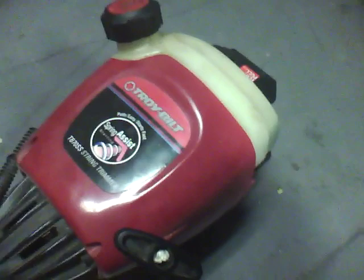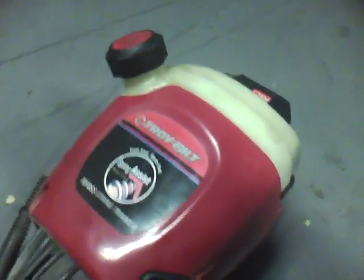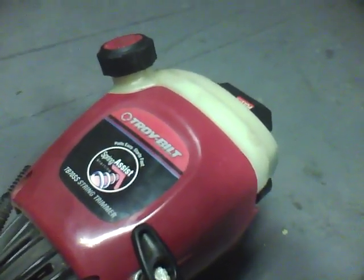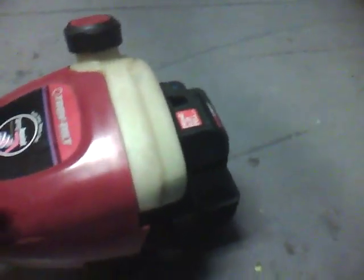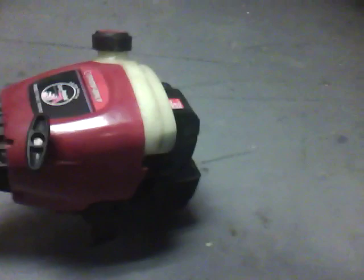The reason why it's smoking so much is I put a little extra oil in the gas. This requires a 40 to 1, but I'm going to run a 32 to 1 in it. A 40 to 1 to me is too light — even with synthetic oils of today, I just don't think that's enough oil for an engine. So I'm running something heavier than 32 to 1 right now. I put a little extra oil in there because I don't know how long the gas has been sitting in there. That's why it smoked so much when it first started up.